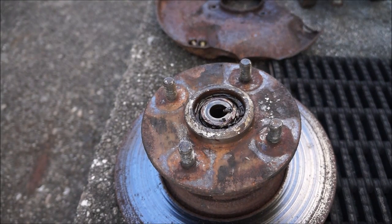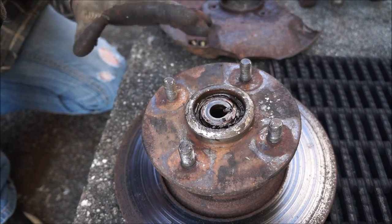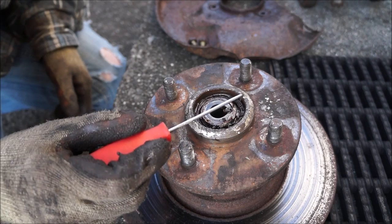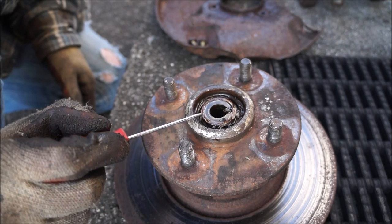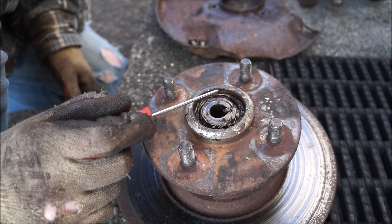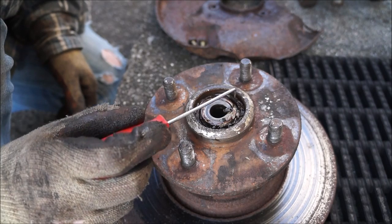I thought when I was looking at these that because they rotate nicely, they don't tink. I think it was rotating the discs and the pads were moving slightly. That's what I think it was. But on closer inspection, if you look in here, you can see a gap in there, and there's some other little gaps, and there's even broken pieces, there's bits broken away. So this grease is splitting, like its moisture is going.